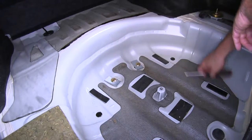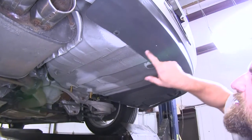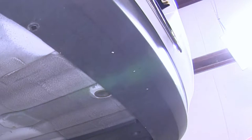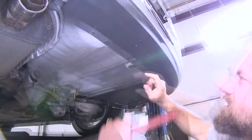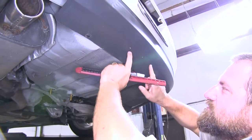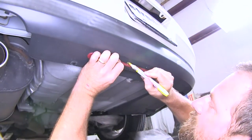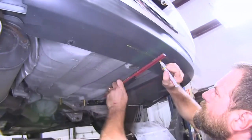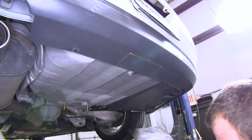Now we can go to the bottom side and prepare to mount the hitch. We're also going to need to trim up the bottom side of our bumper fascia. I've gone ahead and marked the center, and our instructions are going to tell you to cut out a smaller hole, but in order to access the bolts where you have to drill through, I'm going to go ahead and enlarge it just a little bit so we can see what we're doing. So we'll take a straight edge, mark this out, and go ahead and cut that section out.